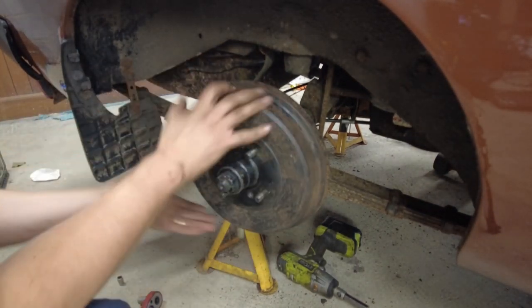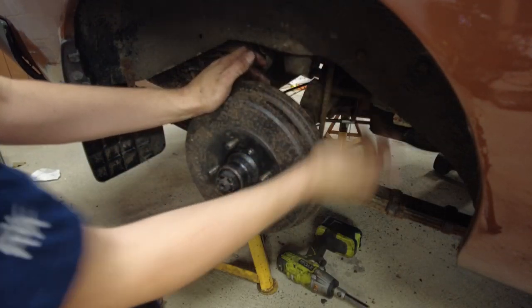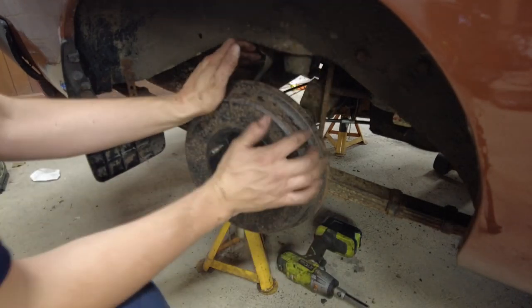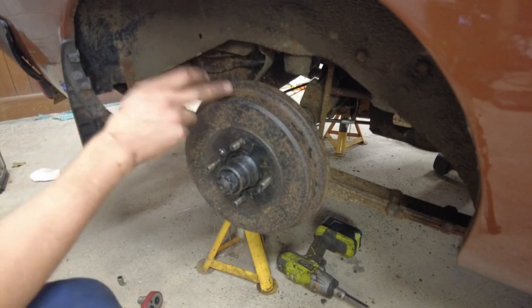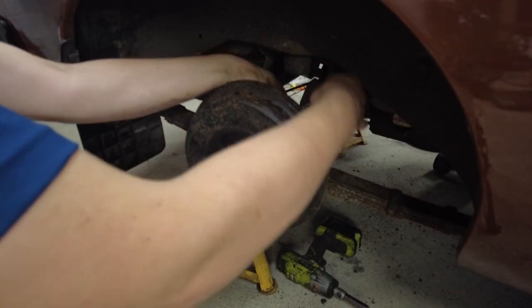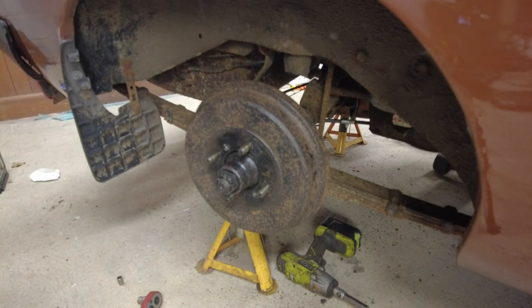So it kind of clicks as you turn it, because there are little flats on the cone-shaped piece on the bolt that goes through the adjuster. What I did basically was keep the drum turning, kept tapping it as it went around, got to a point where the adjuster tightened and the drum was locked. From that point I went back two clicks. We could probably go one more click - let's try. No. Good enough, that'll do us fine. Let's do the other side - I've good mind to take it apart and clean it anyway if it's like this one.